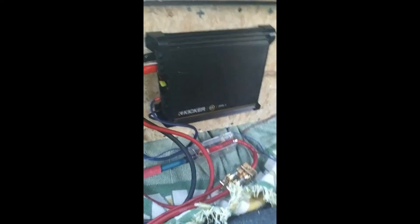If you remember, the DX series amps don't need a remote wire like normal amplifiers. It has a 12-volt turn-on but also a signal-sensing feature — just by noise on the RCAs, the amp turns on. Every time there's bass, your amp will be on. The only maybe bad thing is if you're playing it really low it might not kick in, but you'd need to have it at volume one or two, and most people listen louder than that.